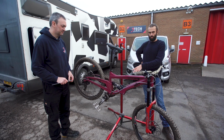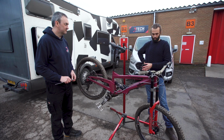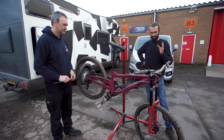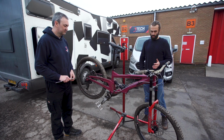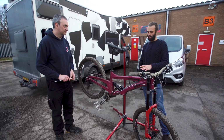We've also changed the spring rate, put a spring spacer on, which Jim's printed, and we've also dropped the NSR damper into the fork. We should have been doing a race only coil spring conversion in the Boxer as well, but that's stuck in the post thanks to Brexit. So the fork's not quite finished, but can you just give us a little overview of what you did?